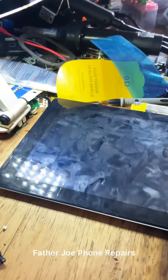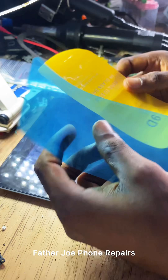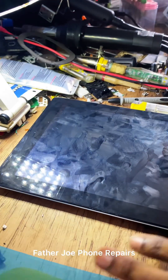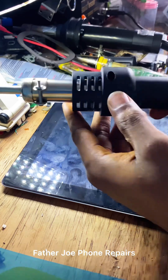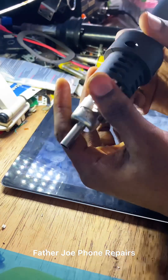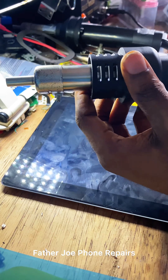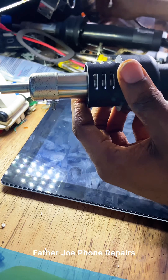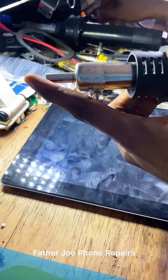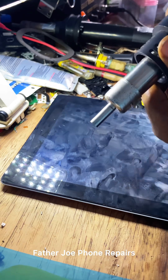Let me start the work. To fix it, first of all you need to open the phone. This phone you have to start from the touchpad to open it. Some people would think it is difficult but for me it is not. You need a blower — set your temperature to 100 or 120. For the air, keep it at four or five.